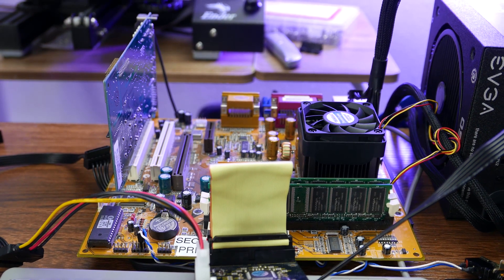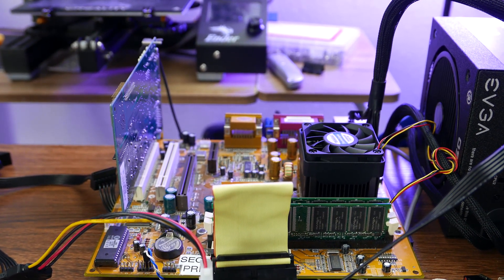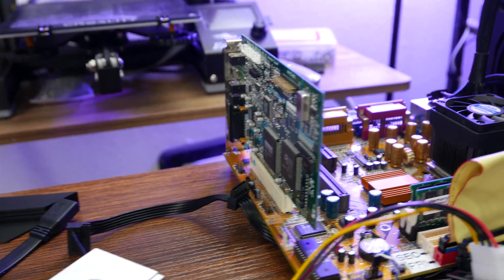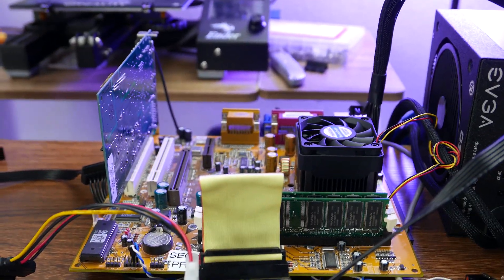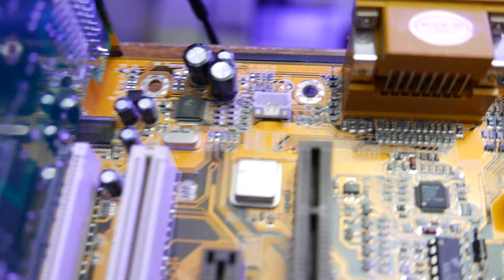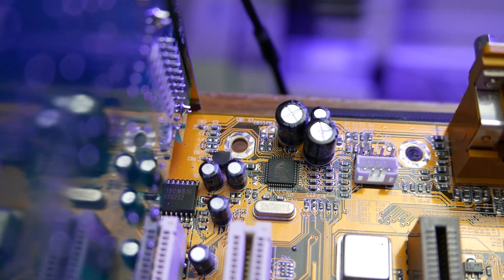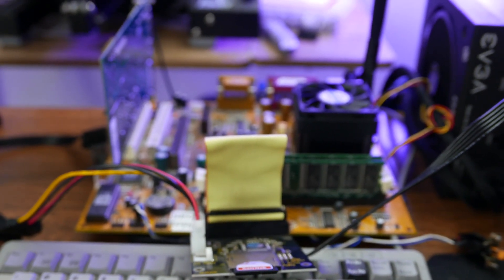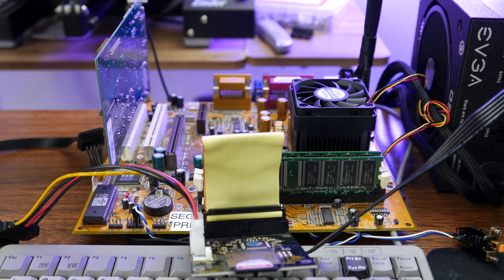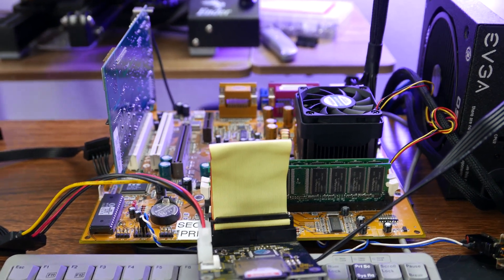Jump cut to many, many hours later. I did a lot more than just download some drivers — I did some investigation. You can see I've got a sound card in here now. That is my original Diamond Monster Sound because I gave up trying to get the onboard sound to work. It's a C-Media AC-97. I tried a ton of C-Media AC-97 codec drivers and none of them worked. I hate AC-97 in Windows 98 — it probably works fine in Windows XP. I'll just use my Monster Sound. It's fine.